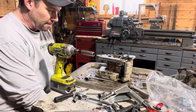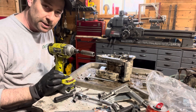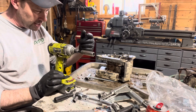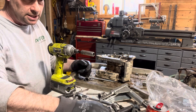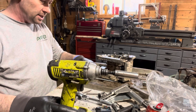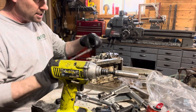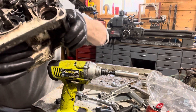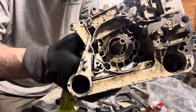It's Wednesday evening. Back on the other 064. This is the one that I thought had the bad crank bearing on the clutch side because I could kind of see the ball bearings falling as I turned the crank. I could hear them clanking. So I was pretty sure there was no cage in there anymore. I just finished scraping some of the mess off, pulled all the case bolts out. We'll get rid of the seal there and try and bring this in so you can see the same thing as I was trying to explain the other day.